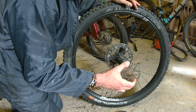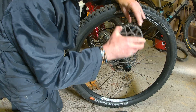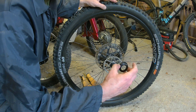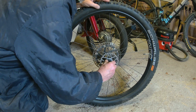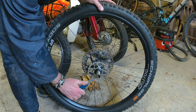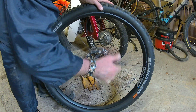We're fitting the new pulley now. There is a bit of a camber on this — the easiest way is to look at the lettering and numbering: 'Carbon Drive CDX' — have that facing inwards, so no lettering on the outside, lettering on the inside. Then it's just a case of sliding it on. I'm putting the spacers back on: two 3mm spacers, plus the other spacer with no measurement on it. Get that started finger tight. We'll nip it up now — 40 Newton metres.